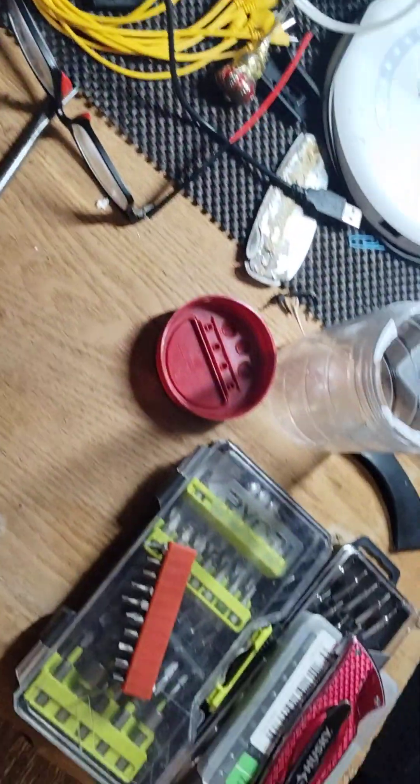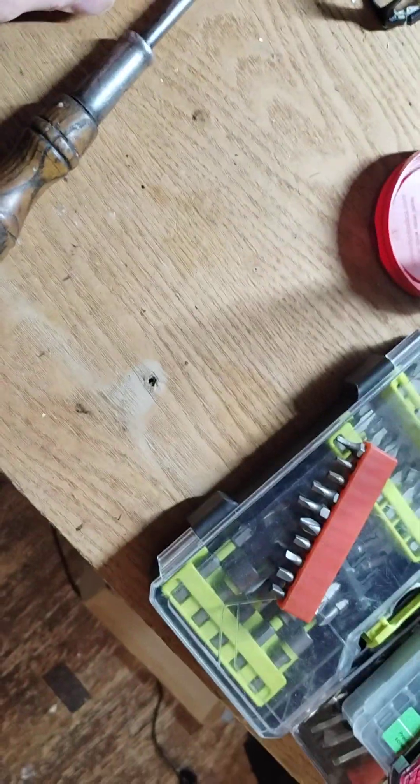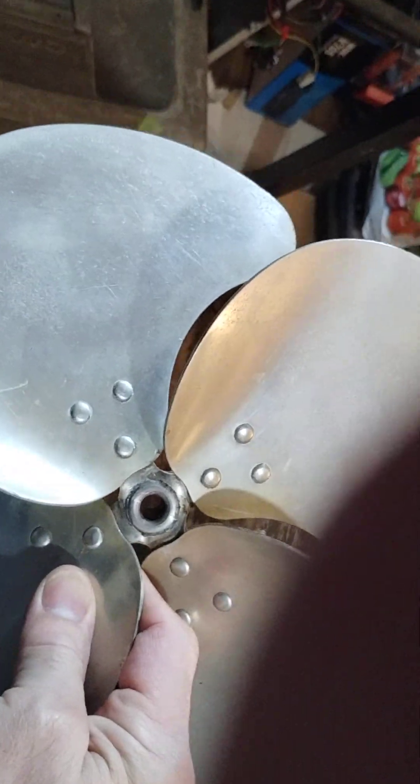That's gotta be painted. The blade is easy to come off — it has a screw, which I already took out. It's a small screw like this. Once you get that screw off, you might just need to take a screwdriver and go like that. Get a screwdriver in there — just have a paint hole in this — go like that, get a gap. Get your screwdriver in the gap and then just push, go like that and loosen it up so it comes right off. It should pull off; you might have to hold the fan. Sometimes they stick. You might have to do that a couple of times with a screwdriver to loosen the fan off the blade, and that's it.